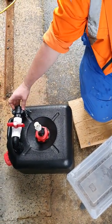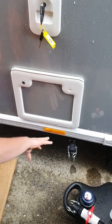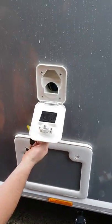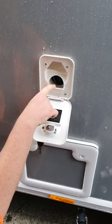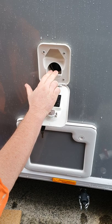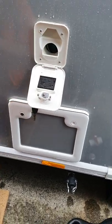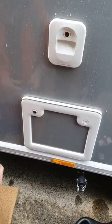And then you've just got your main connection on the big unit here. Just above your water outlet there, this is the filler for your toilet. So it opens up there, fill it in here. Just depending on the model, they take around 8 to 10 litres. There's also a pink liquid which goes in here — it just keeps things smelling nice and also helps lubricate the pump. So that's up there and that just goes into the lock position.